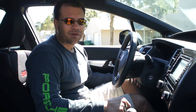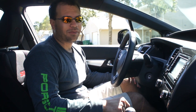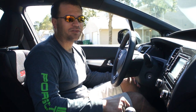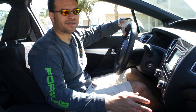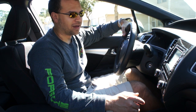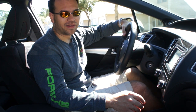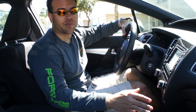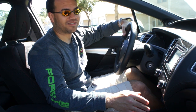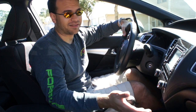This is something done pretty much at threshold braking, which means you're braking as hard as the car possibly can. One thing you really don't have to worry about is over-revving the car, because if you're slowing down, the chances of over-revving it are pretty slim. For all those people seriously considering doing a high performance driver's education event, this is something you're going to want to know how to do. You really can't practice as you're going into a brake zone on a racetrack — it's something you need to develop the skills for on the street, and then driving on a racetrack is almost a practical test for it.